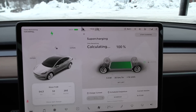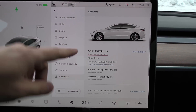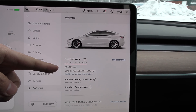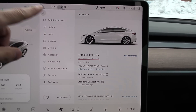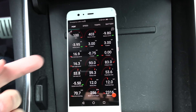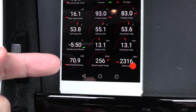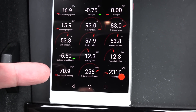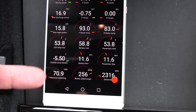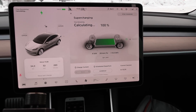Let me show you inside now. The car reports it as 100%, and we have driven 80,000 kilometers. This car was delivered on the 30th of March 2019, so almost two years ago. This is ScanMyTesla — it shows you that at 100% we are still taking five kilowatts. This number here is also interesting: nominal remaining — what the car believes we have before a certain buffer. The last time I measured, we had to subtract a three kilowatt hour buffer, and we got about 68.8 kilowatt hours. So we'll see how much it has degraded over the last seven months and about 20,000 kilometers.